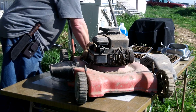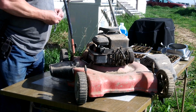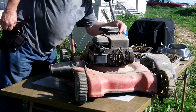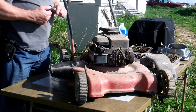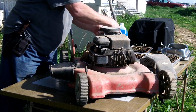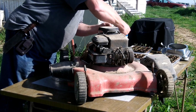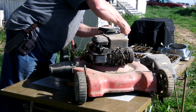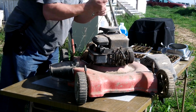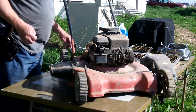Okay, down to a quarter for these little screws for the dipstick and oil fill here. And once again, when you tighten these, you don't have to get all massively studly, because they will strip. They're not real big. Don't need to torque them down to 100 foot-pounds. Basically, I'm using my thumb, just kind of guiding, so I don't put too much pressure on it. Okay.